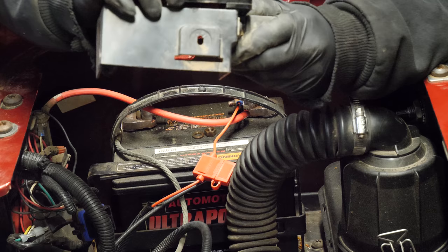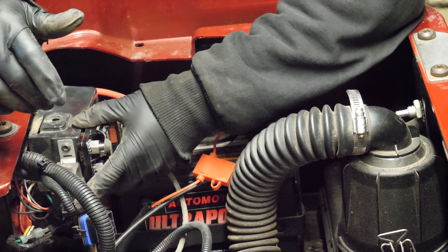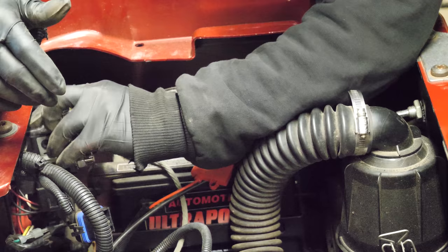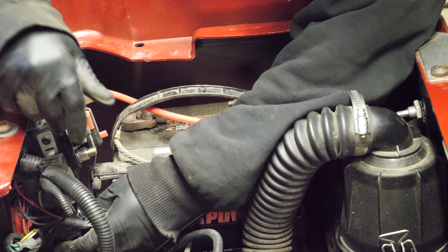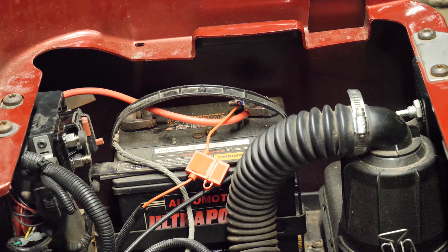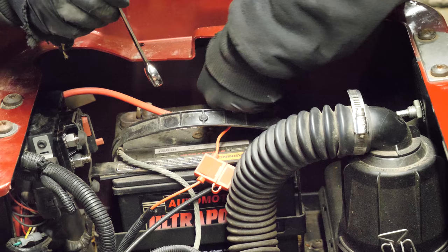Not only that, it does add a little bit of security to your cart — security as in the battery isn't going to run itself flat constantly. So what we need to do is leave that wire connected to the solenoid, and we're going to run all the wires off of that. I'll put that little Christmas tree plug back in there. You will need to add a second jumper wire to go from the battery to the breaker, or from the breaker to the solenoid — whichever wire you disconnect, you still have to replace it with something. I've got a small length of spare wire. Battery negative is already disconnected because we were testing with it.